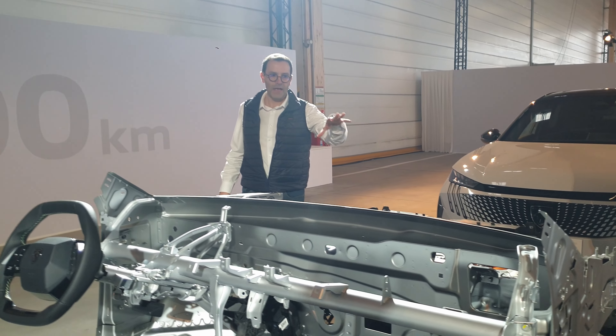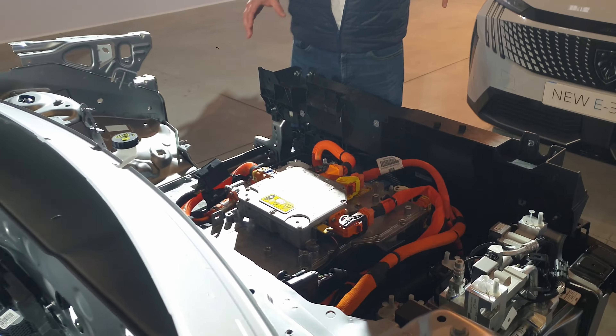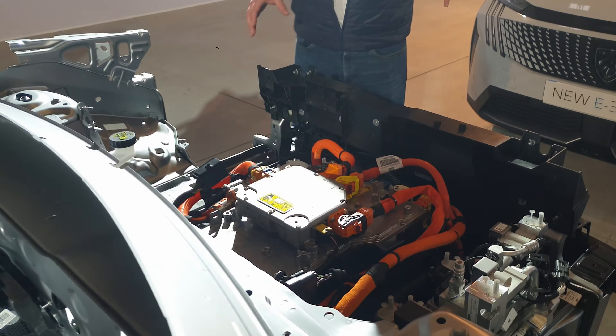Speaking about the propulsion system at the front: there is a fully new electric motor — the big brother of the first one launched with our other GV e-motors. This is the 157 kilowatt e-machine, 210 horsepower, launched on the front-wheel drive standard range. We propose two versions of power output: 210 horsepower for the standard range and 230 horsepower for the long range. This is power that can be achieved even based on the state of charge — something robust.